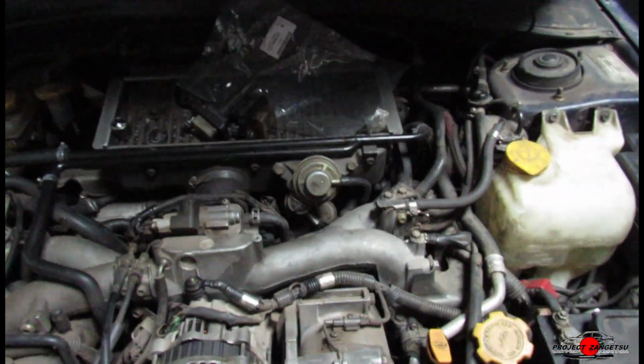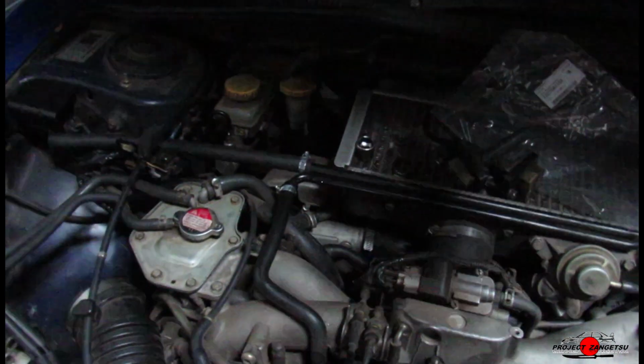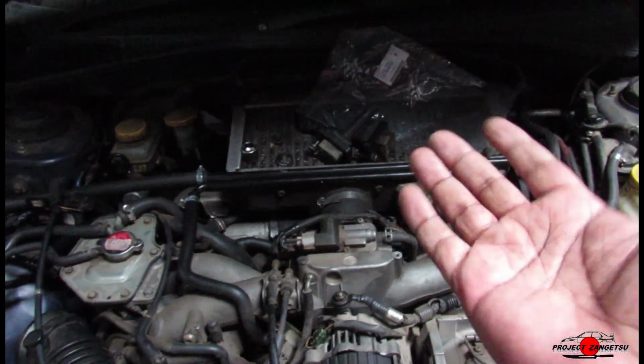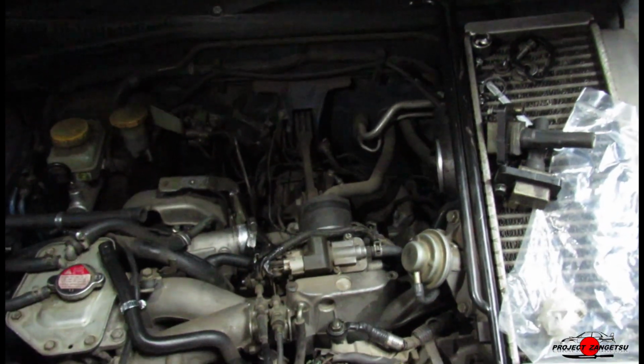the intercooler, which was serving as my tools tray up till this point. I need to basically undo that so that I can remove it, so that I can get access to the pitch stop mount, which is basically mounted between the firewall and the gearbox, the transmission, so that it doesn't impede the engine's levitation when I jack it. So, gonna be quite an involved process. Wish me luck.